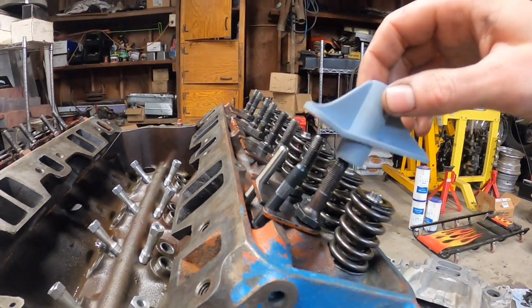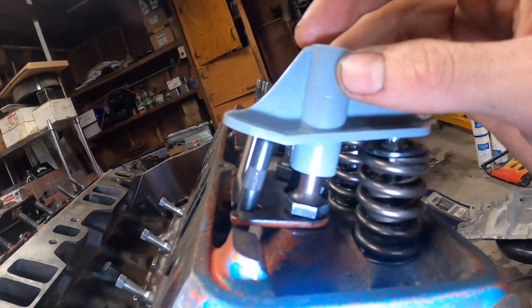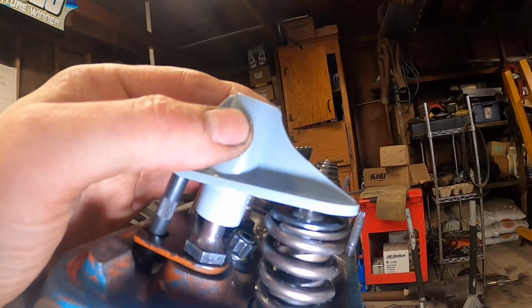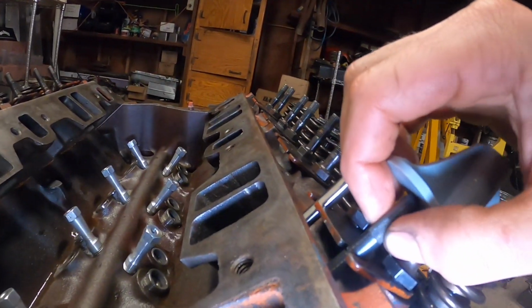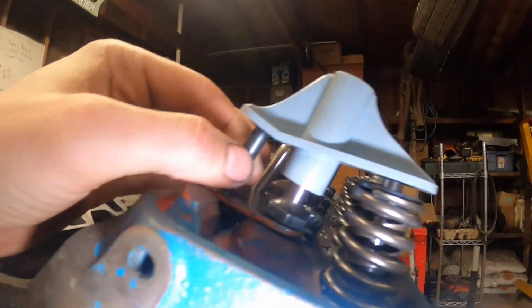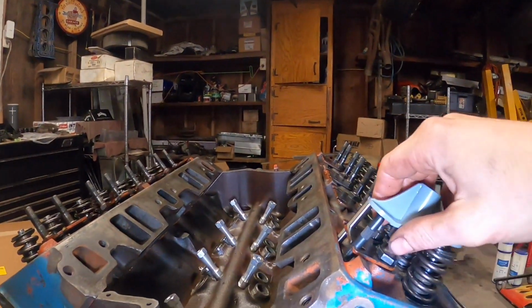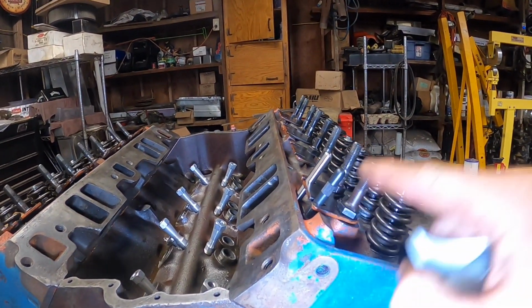Let's see what she looks like. Light back on. Okay, now 50 thousandths is too much because we've come off the valve tip here. So let's go ahead and do half a turn instead of a full turn, which is right about there, I think. Okay, that is touching. So basically this push rod on this exhaust valve needs to be about 25 thousandths longer